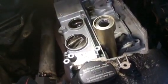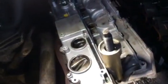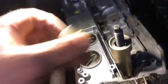You'll need a magnet because there's a tiny moon washer in there that locks everything in. But once that's out, you can drop this tool in, and it's only a few quid. I think it was 20 quid on eBay, but it's such a nice little device. Drop the inner pin down, thread it into the injector, and you can drop a nut down on the top.